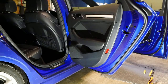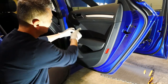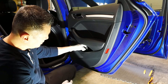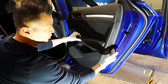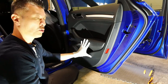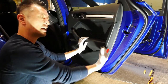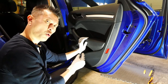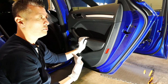While I'm at it, I wanted to show you the back door as well — it's pretty much the same as the front. You've got your speaker cover right here, remove it, and your third bolt is going to be here. Remove this, and then you'll go ahead and slide your tool underneath, pry it open, get your fingers, and pull your panel off. It's pretty much exactly the same as the front all around. The only door that's going to be a little different is the driver's door because it has the power window control mechanism, but the process to remove it is exactly the same.